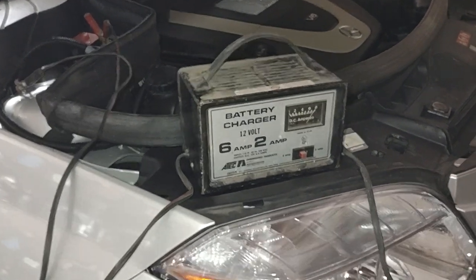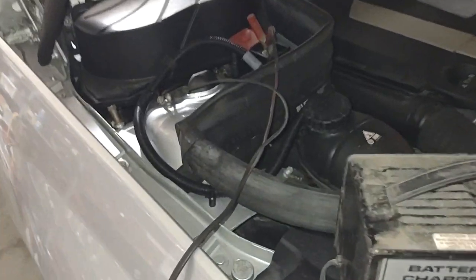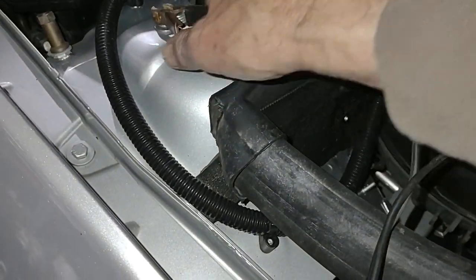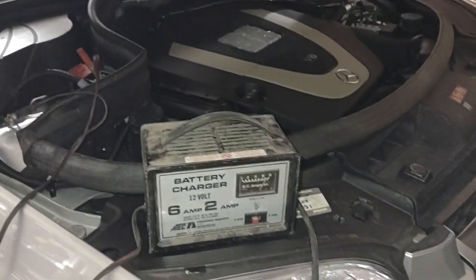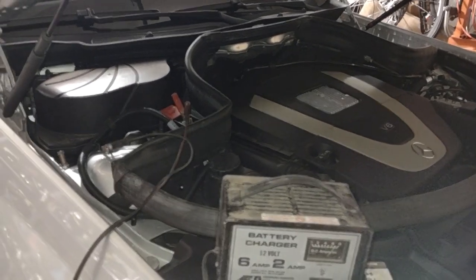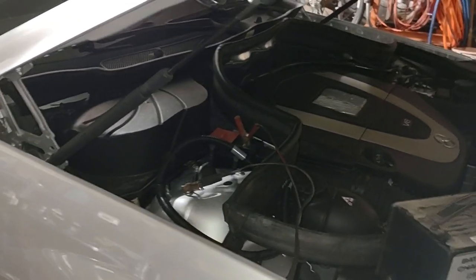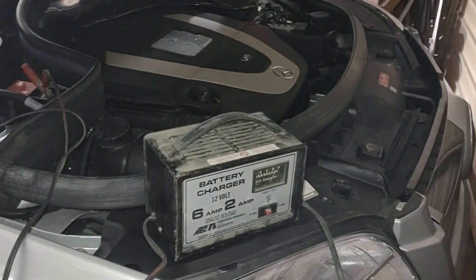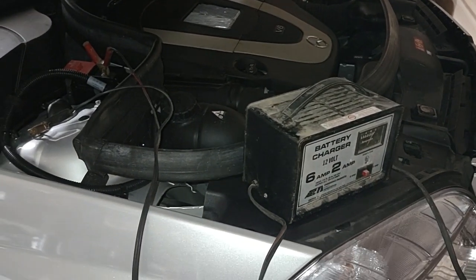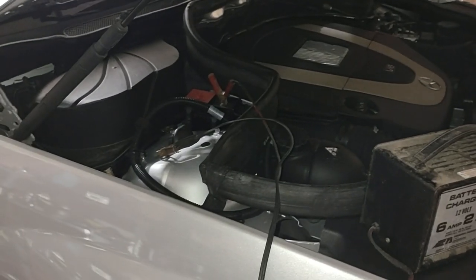To do this process, I'm going to hook up a battery charger — a 6-amp old school brute force trickle charger — to the underhood access point and to ground. I just got done installing fog lights and had the ignition on for a while. If the head unit sees the voltage drop just a little bit under 12 volts, it shuts off. So if the whole thing goes black in the middle of your job, you need to start the car or hook up a battery charger.